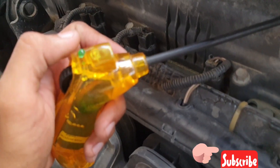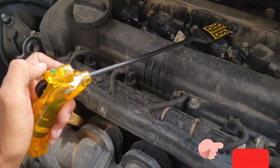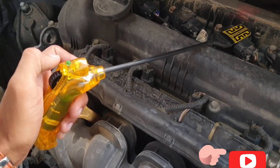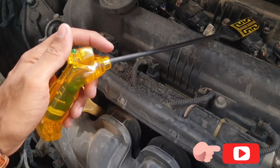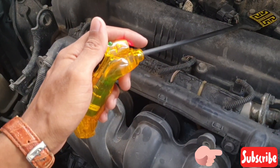Touch the upper side of the ignition coil there. You can hear a sound and see a red light. If your ignition coil is perfect, you can see the red light pulse — that means the ECM pulse is coming properly.